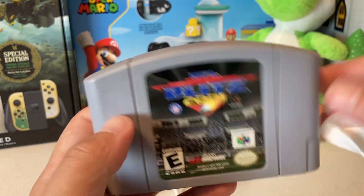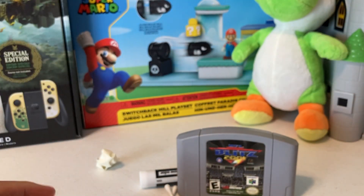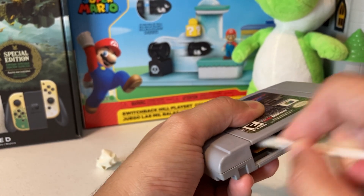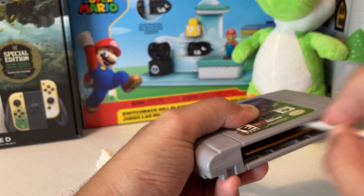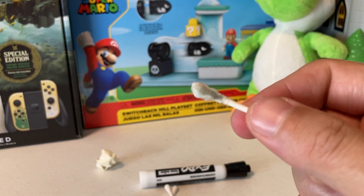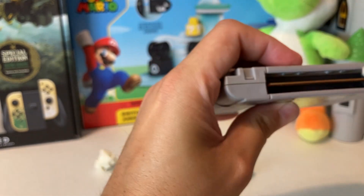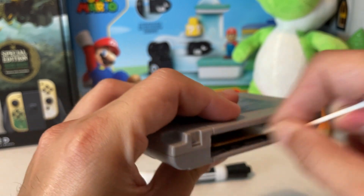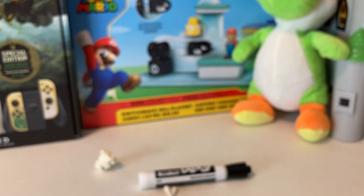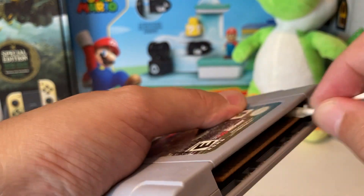The last part: we're going to take some isopropyl alcohol and clean the pin connector. If this is super dirty you're going to see what I mean. Take a Q-tip and run it along the pins over and over and over again. Let's see if it's dirty — oh yeah, look at that! This game probably would not have even played. That is disgusting. What I do is clean one side then do the other side too because both sides are going to be very dirty. I just use the clean side of the Q-tip and repeat the process until the whole thing looks absolutely disgusting on the Q-tip.